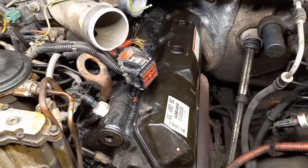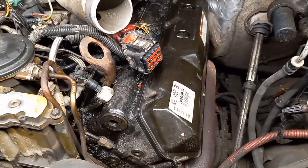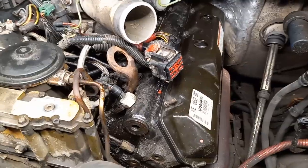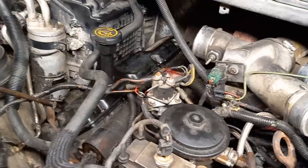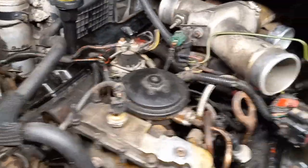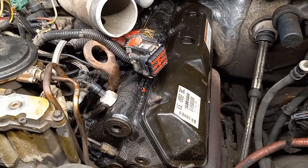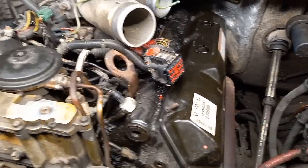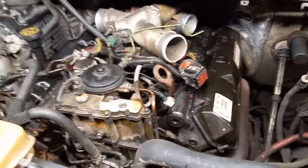That includes intercooler pipes, some of the heater stuff, some electrical — all this, that and the other. Otherwise it's pretty simple. This machine is about to the point where I'm about to reassemble everything on the top side of the engine. Both sets of injectors have been re-o-ringed. It's got new under-cover wire harnesses, new glow plugs, it'll get a new glow plug relay, a new camshaft position sensor, and a couple other little items. But otherwise this utility truck will be back to work.